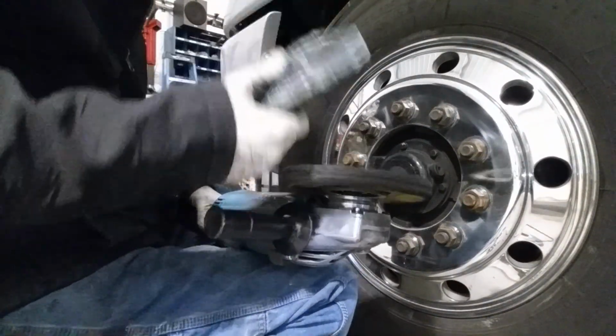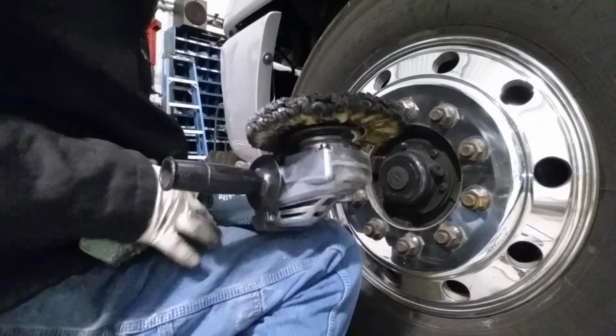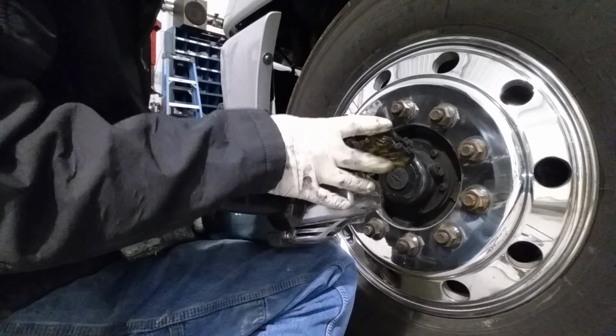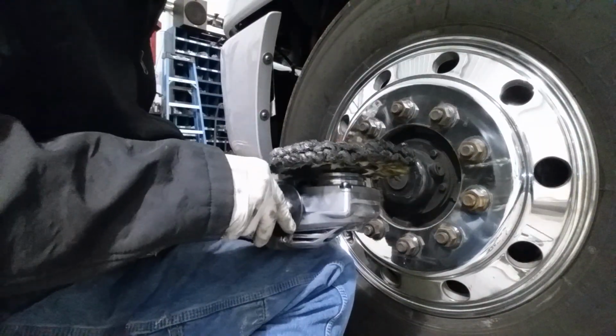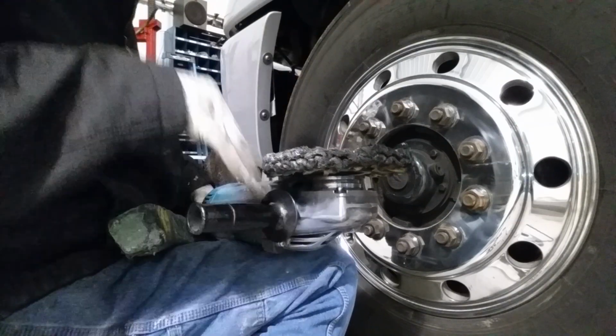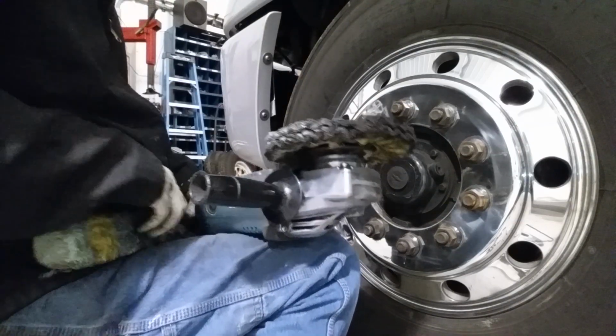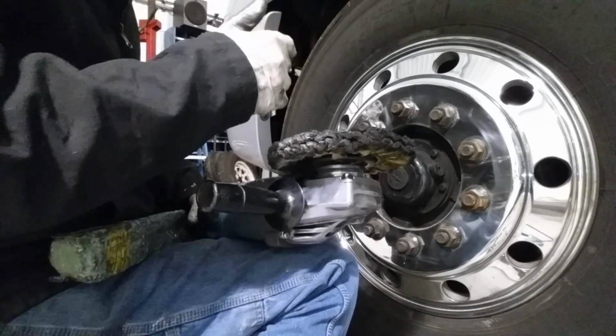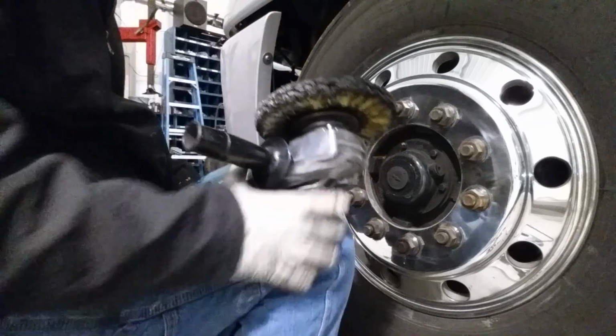You're going to stop at the green secondary polish. You don't want to have too much buff polish on your pad. You want to keep it as light as possible so that you get less buffing lines on the product. So you want to have enough to do the job, but not so much to create buff lines on the metal.